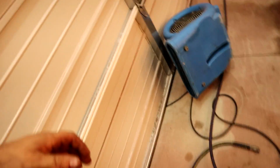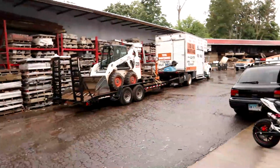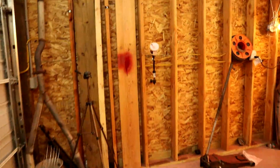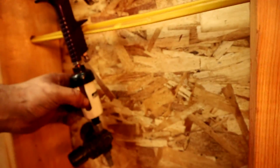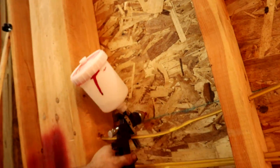I did get a little bit of water in the line because, you know, quarter way in. Can't stop humidity, you know. And I did try. Gotta give me credit. I did try here, but you can see how that's pink. They were blue. They changed colors. Yeah, so that's that. I cleaned out the gun. I have some stuff sitting in it because I have to spray the skirts and whatnot. I got a medium reducer, and I think I should have got a slow reducer.